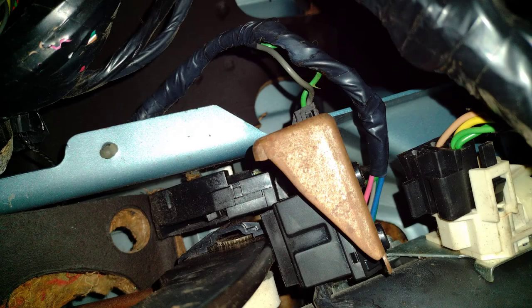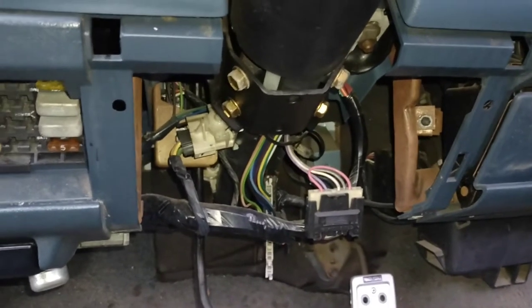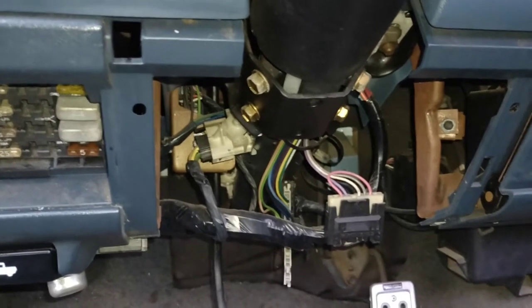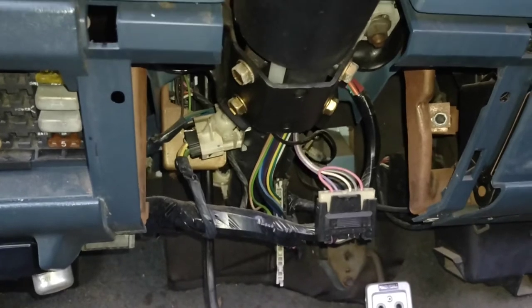Lights are turned on and off with switches so I started there. I followed the brake pedal arm up and I found these two switches, so I'm going to see if one of these is the cause of my problem. I took the trim piece that was just below the steering column off because it was a pain to get at the brake switches otherwise. I mean it's still a pain but this will make it a little bit easier.